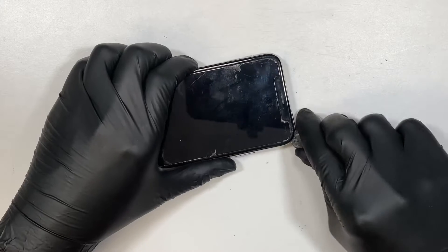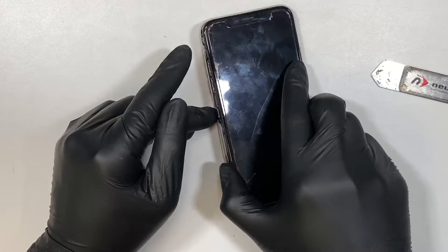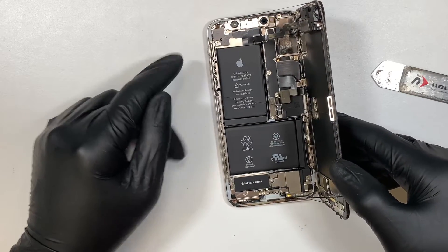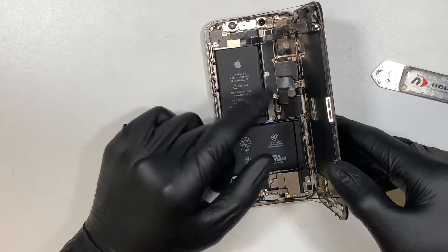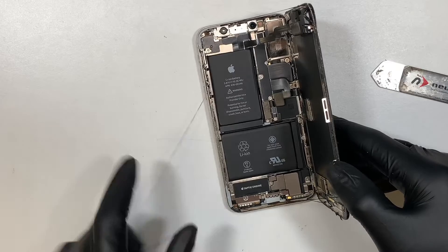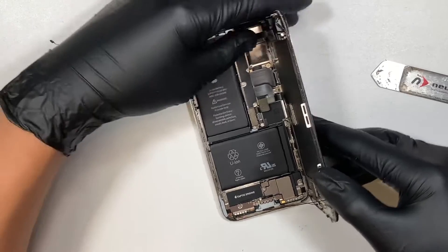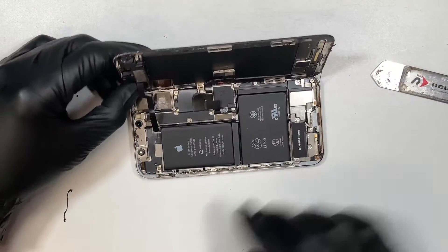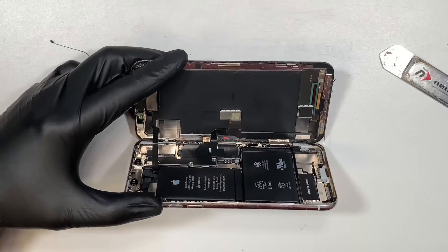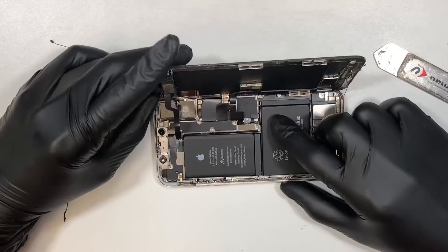At this point I'm still having some difficulties. Once you have the seal cut, you can flip the phone to your right — that's how you open it up. You see this little stringy, looks-like-cheese material? That is the seal that prevents water from getting in. Once you remove that, turn the phone around. This phone has water damage — you can see the indicator has turned red, meaning there was water in the phone previously.